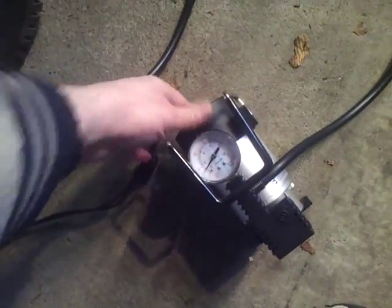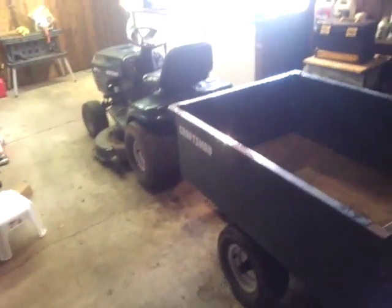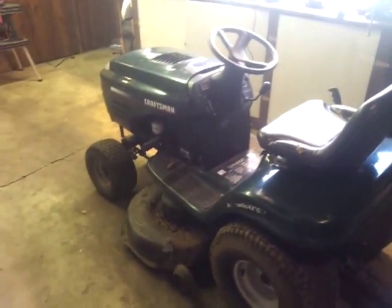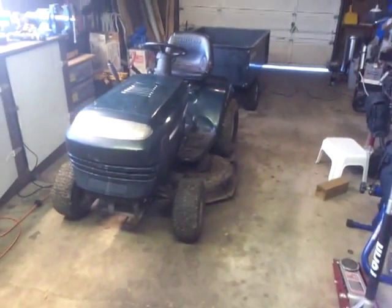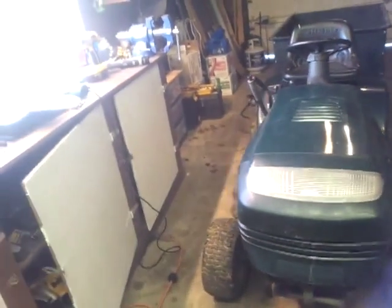Just taking care of the last couple of little doodads to get my awesome little yard tractor ready to roll. The tractor is actually ready. I did an oil change, I had to replace the starter relay, pulled the blades and sharpened them on my crappy little bench grinder. Inflated the tires, added some gas because gas was really old and very low. Put new oil in.